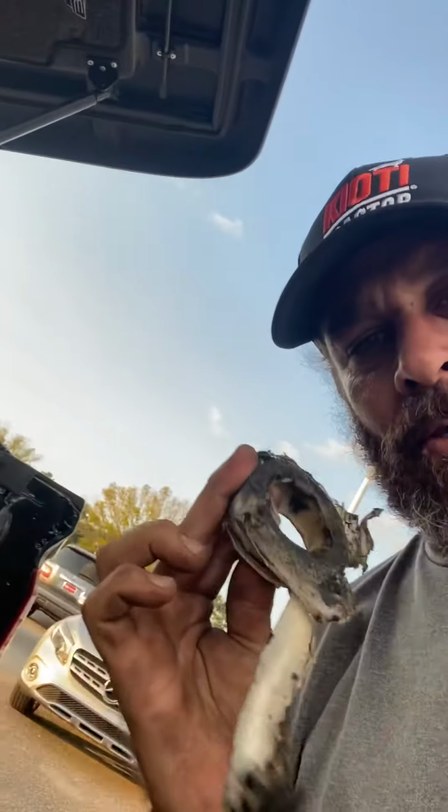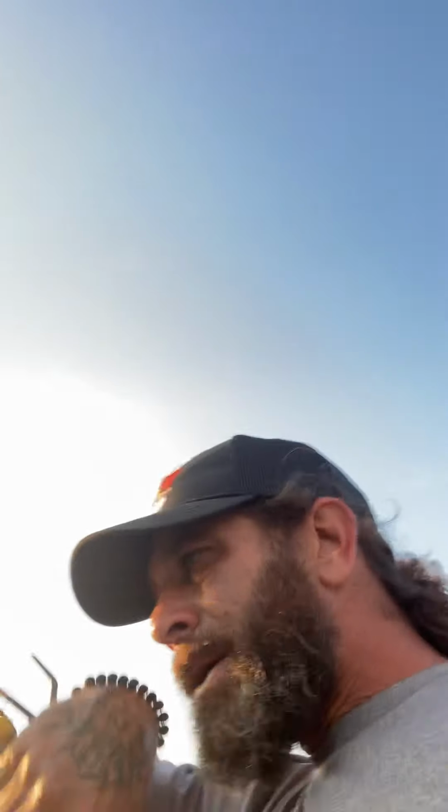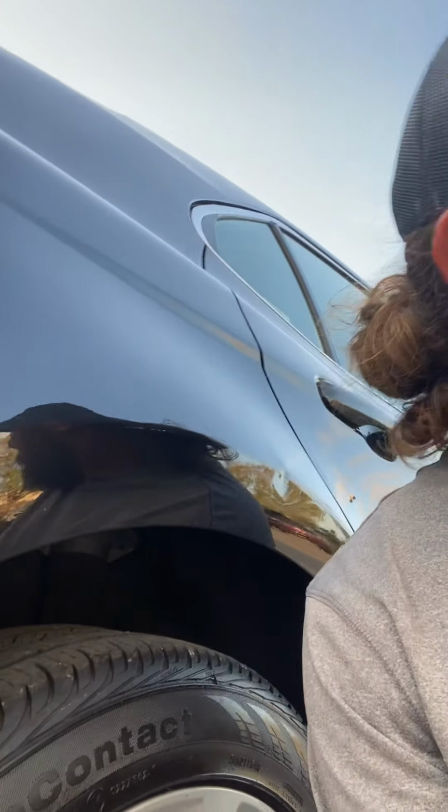Rather than taking the taillight out of a Camry, you gotta drop the whole bumper out so the taillight will come out. I'm not even bothering or dealing with that. So I'll use one of those. We're just gonna go in through the bottom of the liner. We'll pull that liner back. We're gonna use an awl to get inside of it. And then at the end, we can use some butyl tape and seal up that little entry hole in the bottom, because rather than drilling in the quarter panel and going that route, we'll just go from the bottom here.